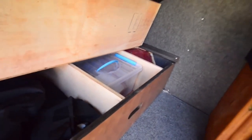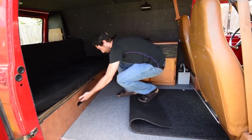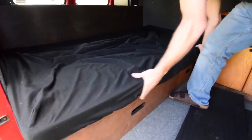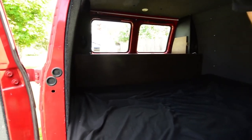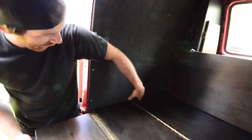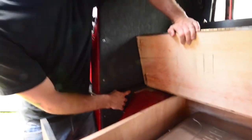Nice long piano hinges really add more stability to the function. Three relatively large storage bays. Now, to convert, it's quite simple. All you really do, get this out of the way, my two handholds here, slide that bay out, and that folds out. Now, the back moves up into an upright position to give a few more inches. And it's about the size of a twin, I think. It's about six feet long, so I think a twin might be a little bit longer, but I'm only 5'8". How it's mounted, I've got a piece of angle iron running this length here, 90-degree angle iron on both sides. That's mounted to the wall and the vertical struts, as well as screwed into the wheel well. So it's pretty secure. That gives a nice base for the bench seat.